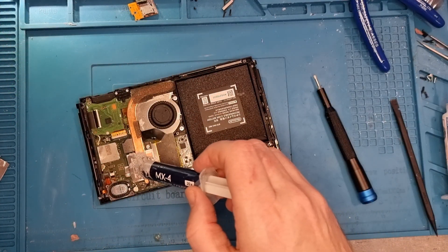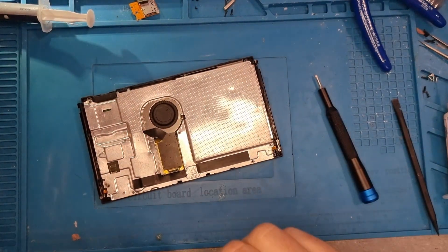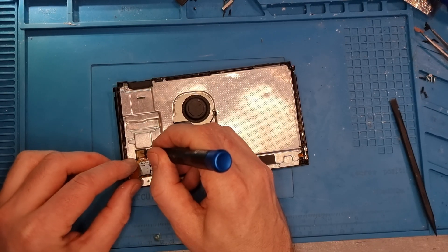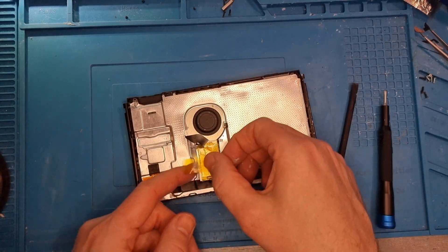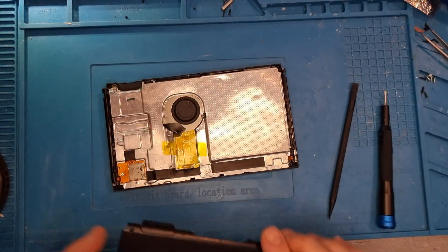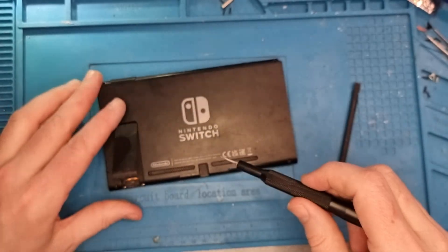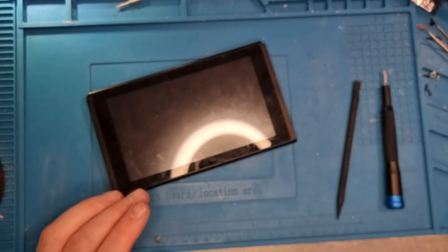Apply a little bit more thermal paste, then reconnect the battery. Put it back on with a little bit of kapton tape on either side of the chip to stop any potential shorts. All the screws go back in, SD card connector lined up and pushed in, the screw into that, a little bit of foam to stop it moving. One more piece of kapton tape to stop the chip from moving. Give it a quick dust while you've got the back off — you might as well. Then that clips in and all we need to do is reapply all the screws — the Phillips head screws along the edges and then the tri-wing screws on the four corners.